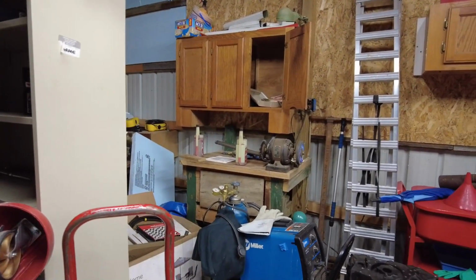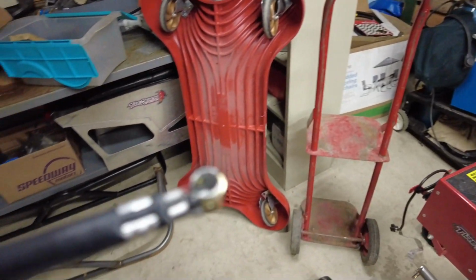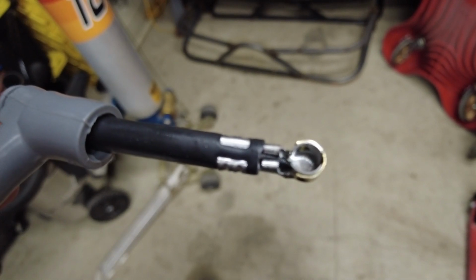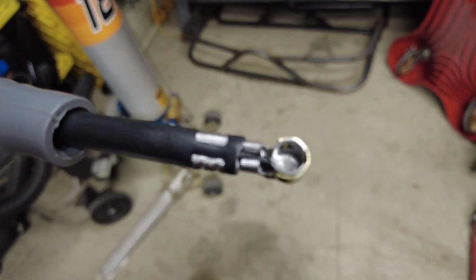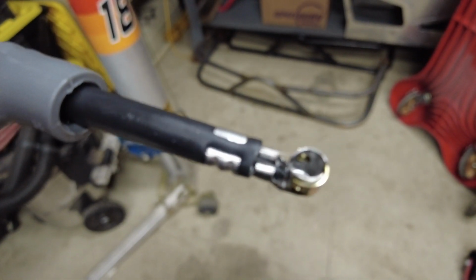This is the last one. And get this to focus. You know, they make that little crimp tool. It's really going to be hard to get this focused. There it goes. All right, they make that little crimp tool. It comes with the plug wire kits from MSD. And I always find myself having to adjust the crimp here with a pair of pliers, but it really does help get those corners pulled in so you don't end up with a weird crimp down here on the insulation. So that's cool.